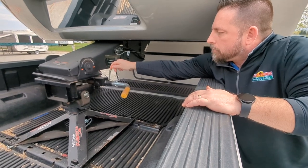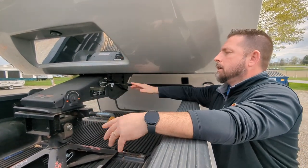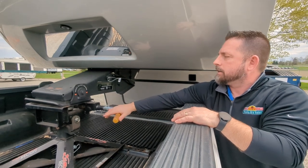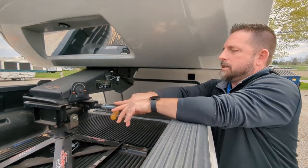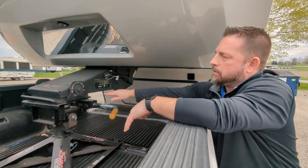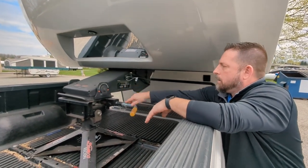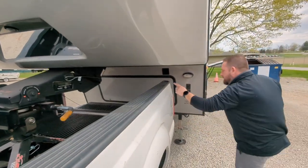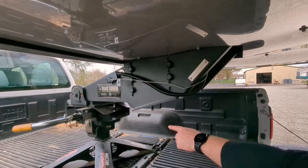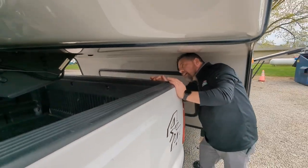As long as our pin will go down through this, we know that we've latched all the way. Typically I would leave the truck running just to make sure I've got it in place in case I have to move it, but for the video we shut it off. I know this locked in tight. When I came back I wasn't lined up 100% perfect, but that's okay because there are angles on the hitch itself that'll kind of maneuver around with you to get under. That's another good reason why we have this about an inch lower — so you have that pressure so the hitch can move where it needs to go and lock that fifth wheel in tight. I always step back behind it and take a look to make sure that the latch went across the jaw. You can see right in there, our bar is all the way across it, so we know we're locked in tight.